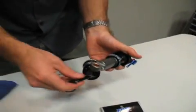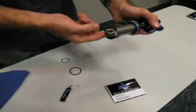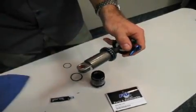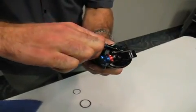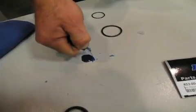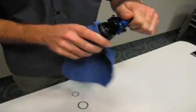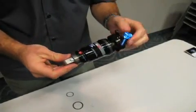When reassembling, put just a little bit of lube on these seals — just a drop or so — and work it around to coat the inner surface. Do the same on the seals at the other end. Then add a little extra float fluid inside — about the volume of a nickel poured out flat. Just enough to slosh around inside your air chamber and keep your seals lubricated until the next service. We recommend servicing these shocks every 8 to 40 hours depending on your riding conditions.